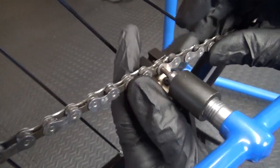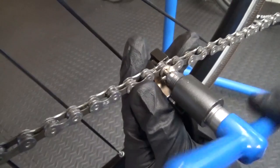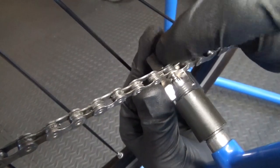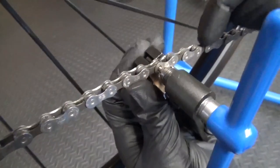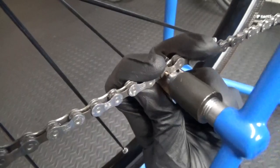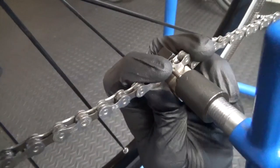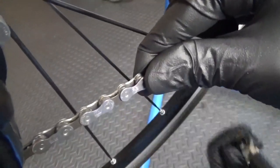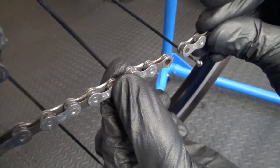Bear in mind, when you push this through, push it right through — keep on going until it comes clean out the other side. Now basically this acts as the pin and the pin's come out the back there, as you can see. When you undo this, you can put a piece of wire between either side if you want to hold the chain while you undo this. That's why you put the derailleur into the lowest at the back, so it takes some of the tension off. Undo it all the way out and we're left with two ends — a male and a female end.